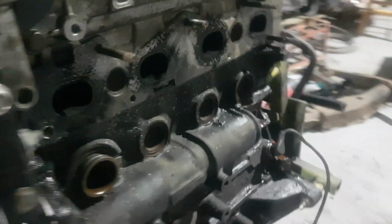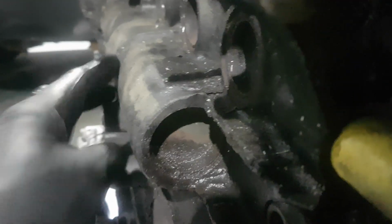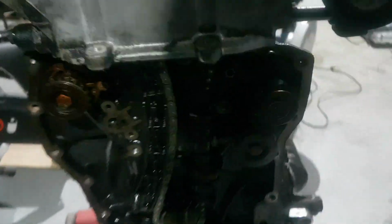And also, there's an oil feed that comes up to the shaft bearing here, and also here as well, another one there. So to gain access there, Nick sends you new core plugs for there and there. Once your balance shafts are out, knock these out, and then you need to knock the bearings across here. Now these are a pain to do, especially if you get the wrong size blanks off Nick.